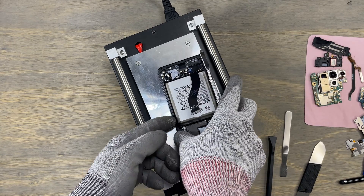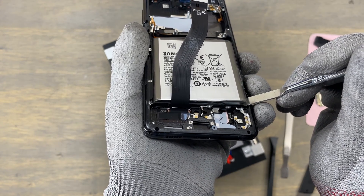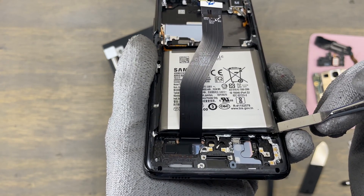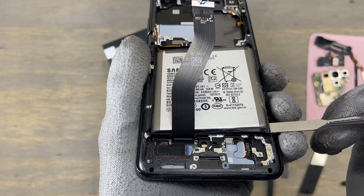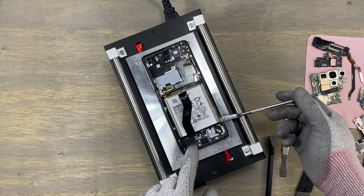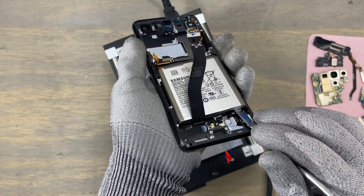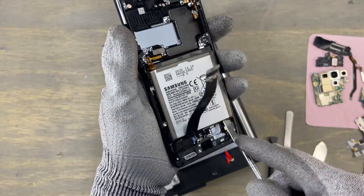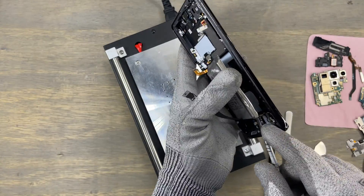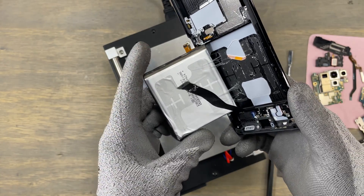The final part is to remove the battery of this S21 Ultra. Removing the battery can be difficult due to the amount of glue that Samsung has put on the back of the battery. I found that the easiest way is to preheat the screen of the device. Naturally, the heat will go through and soften the glue on the back of the battery. I use a metal tool to apply some pressure upward so that the battery can lift up. This is the easiest way to remove a battery on a Samsung smartphone.